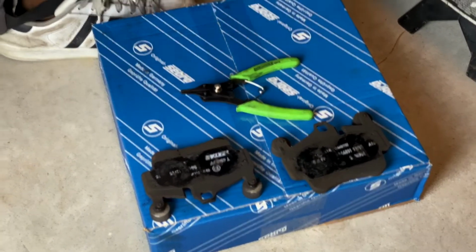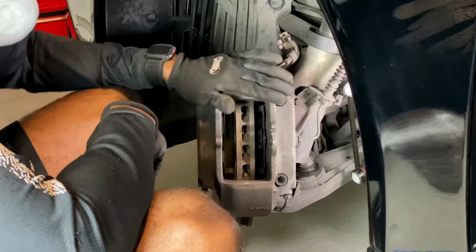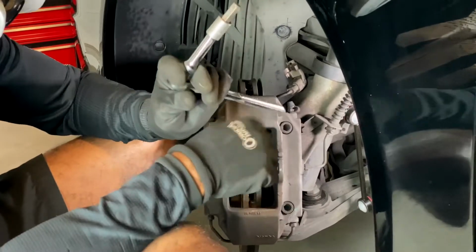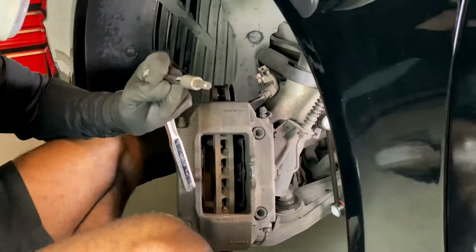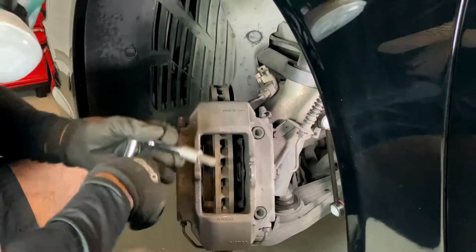So now I'm going to go ahead and take my actual caliper off and then my rotor. To take my caliper off, I have to use this brake caliper removal tool. It says CRV 10 on it, but I don't think that's the size of it. So I'm going to find out what size this thing is and put it in the description below.